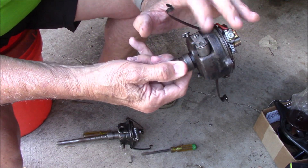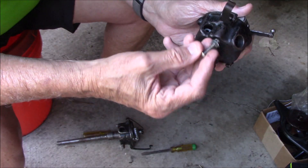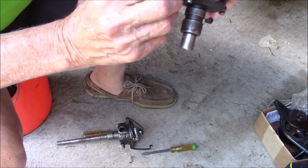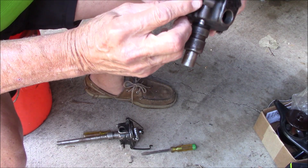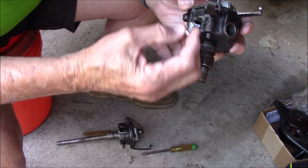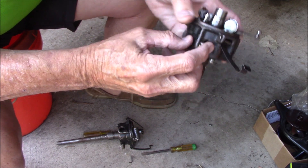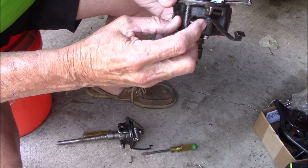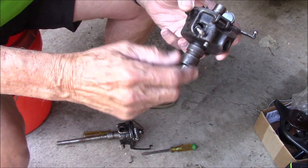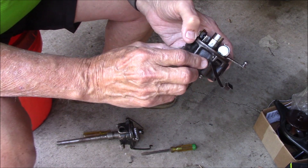If you take a screw and contact that lower plate in there and fasten that screw to it, if a problem comes up you can troubleshoot your car by simply hooking a jumper with an alligator clip from here to the passenger side of the coil. That bypasses your switch and everything and should make it start.